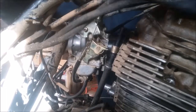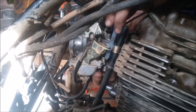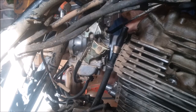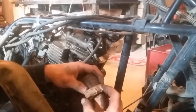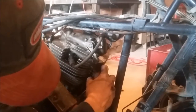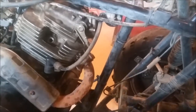For the carburetor, I don't have a clamp that size so I'm just going to use a zip tie — it'll be fine. These two pieces go right there, that makes this deal a whole bunch longer and it'll compress the ring so it'll all fit in there right. Before I tighten that up, there are two bolts back here on both sides — I'm just gonna put a bolt in there and leave it loose, then tighten those two front nuts first, then we'll put the muffler on.